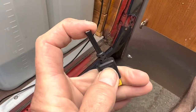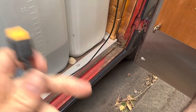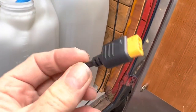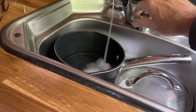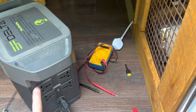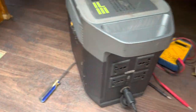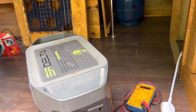With hindsight, rather than cutting that wire, you could get a female plug with two wires so it just plugs into the female side — but easy with hindsight. Moment of truth and that works absolutely fine. Now we've got the pump powered by the EcoFlow Delta via the 12-volt socket, which frees up the other four AC plugs. The hot water system can plug into one of those if needed, still leaving three plugs free, and the fuse box can plug in to give us all the sockets around the van.